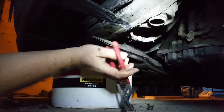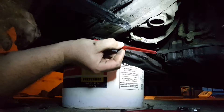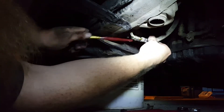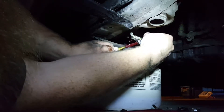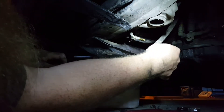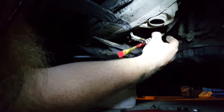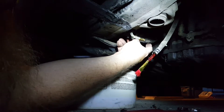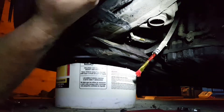For the other oil cooling line, I already moved the clip back. To get the hose back, rather than doing any twisting, I'll just take the small channel locks on either side of the pipe and push back gently until it almost comes off. I stole a child's paintbrush — I didn't have a second ballpoint pen; all the pens I had were really nice. I stuck the paintbrush in there and now I've got two stable plugs to keep them clean and keep oil from coming out. The radiator is now disconnected except for the big lower hose.